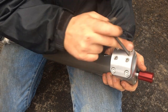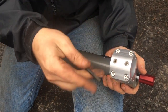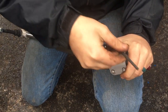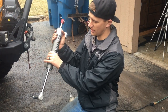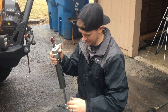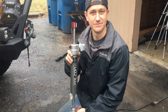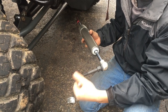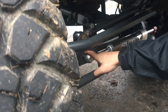Now we'll focus on the stabilizer. These are all five-millimeter bolts — these four bolt the two pieces together, and these two have little points on the inside that actually stab the tie rod and keep this thing in place. We'll loosen these two up so they're not pointing inward at all, then completely remove this clamp and get it attached to the tie rod. We started this project with the tires perfectly straight forward, so now we want to make sure the shock body is centered between these — basically the same length on both sides. Now we can put it on the Jeep and place it in the hole where we just pulled that bolt out, right there on the track bar bracket. This end will rest on the tie rod, so we can get the nut on this end and get it tightened down.